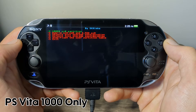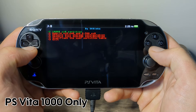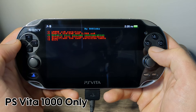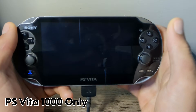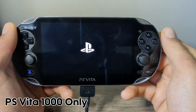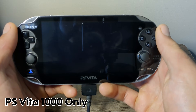If your app crashes, close it and try opening it again. But once you are here, go down to the second option — Default to XXX Storage Configuration — and press X. Then press any key to reboot. The PS Vita 1000 does not have internal memory, so that is what we just did: set it up with the proper storage so that we can set up our homebrew.